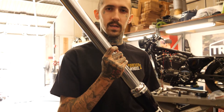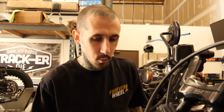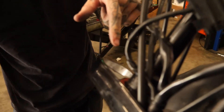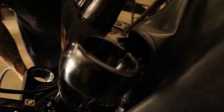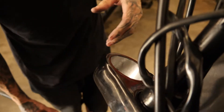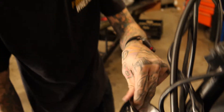We're back — we had to take a little break, things got busy and we had to install a damper kit. Now it's time to throw these forks back in. A little PSA: we're finding out that whoever powder coated these trees decided to powder coat inside of the bores — see how it's all black in there? Not a good sign. The tolerances are tight to the point where the forks almost don't want to fit, so you have to go in and remove all of that. If you get your trees back like that, make them redo them.